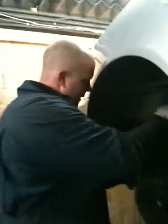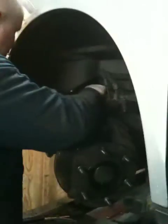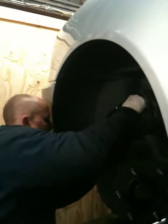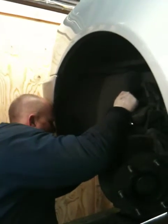Right, now, roughly, when you get it that sort of tight, don't over tighten it, because it is only a little snap off nut, but you know the location of your hole. So, come round to there, get a close up of the hole place, while I get a new split pin. Can you see the nut with the hole in the middle? Right in the middle of the two bits? There, look. Can you see the hole? So when you put your split pin in, it will go straight in there like that.